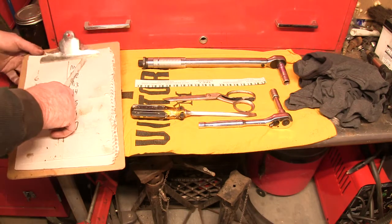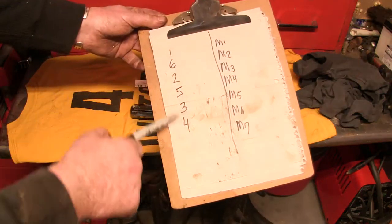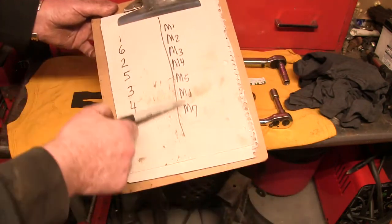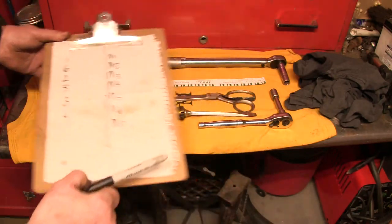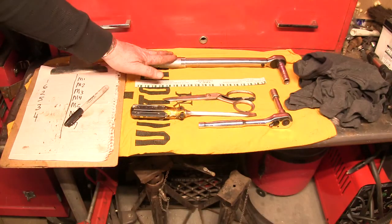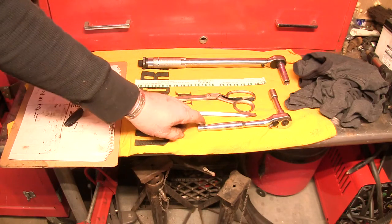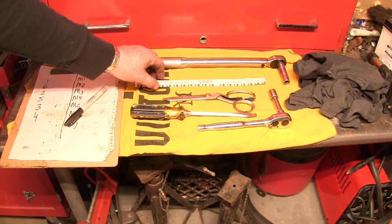And I've prepared a little thing for each of the cylinders, each of the piston or rod journals, and then each of the 7 main bearings in this engine family. Up here is the torque wrench with a 1/2 inch on it. This is a little bit speedier version that'll help me get them off. These will help me get them on.